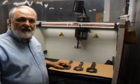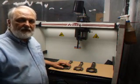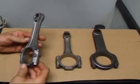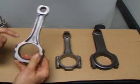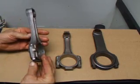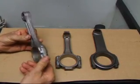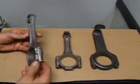I want to tell you a little bit about cast connecting rods, forged connecting rods, and billet connecting rods. This is a cast connecting rod and the way we can tell that it's cast is this small seam that we see on both sides. That's where the thing was actually cast in sand and that's the parting edge. This was cast out of steel so it'll do the job for a street motor quite well. This is actually out of a 3.8 liter Buick engine.